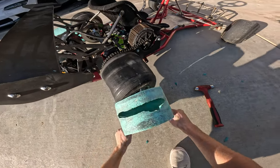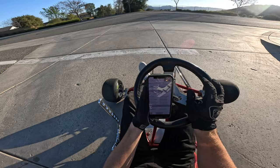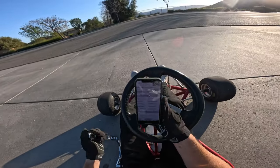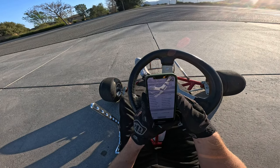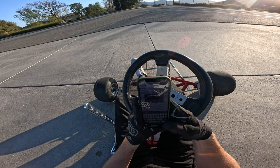Finally I can have my go-kart back. Alright guys, we got the normal tires back on but now I'm trying to get the settings back. We got 7,000 watts, 72 volts. Phase 300, max phase 150 — I think I need to turn that back to 300.